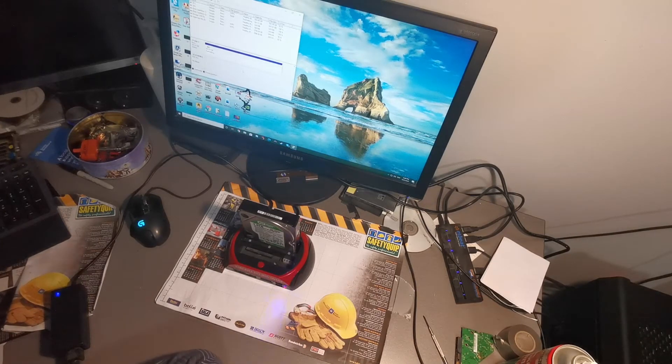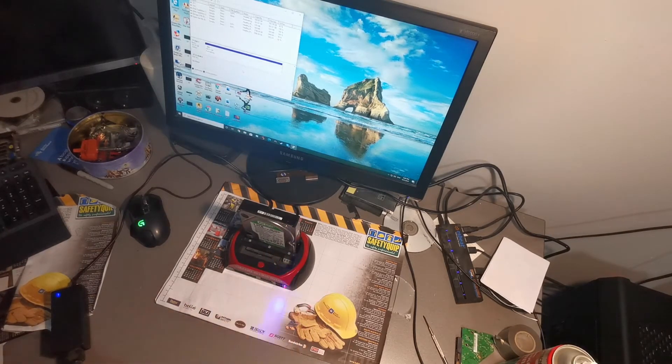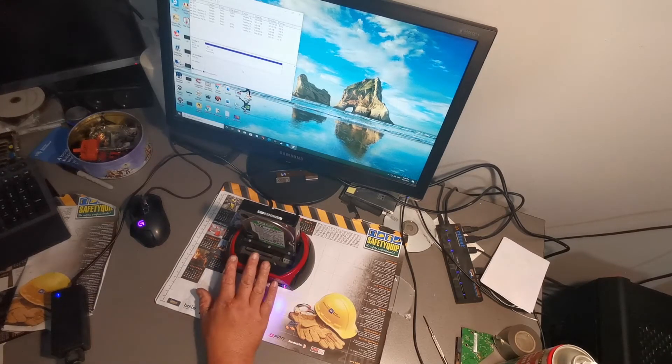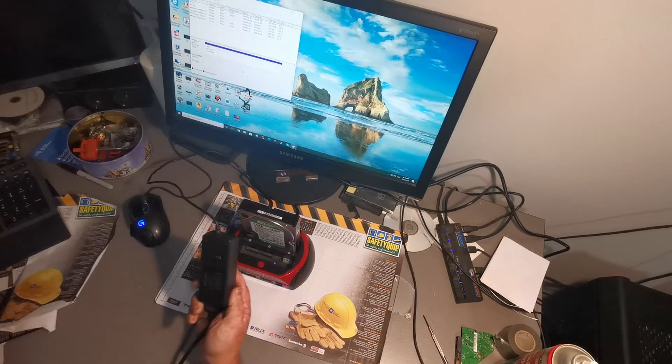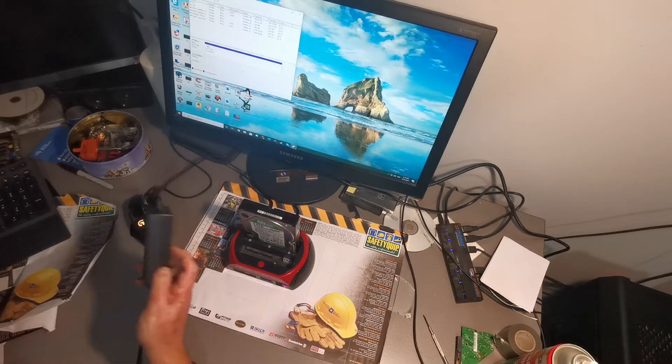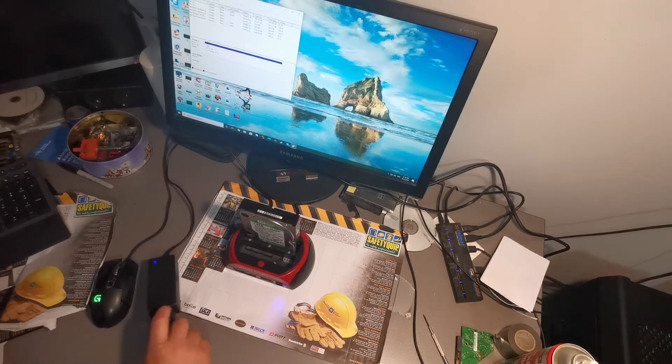If you do have a lot of old hard drives lying around, I recommend getting one of those USB 3 docking stations. They're easy to use, they're compatible with even IDE drives as well. Some of them have the capability to plug in a laptop hard drive. This one's even got a card reader at the front and you can plug in other USB devices. But remember, if you do plug in more items the slower your USB 3 speeds will get to copy and install items on the hard drive. So I wouldn't recommend going and putting multiple drives in there at the one time. This is a desktop version and it comes with a nifty little 3 amp power supply.